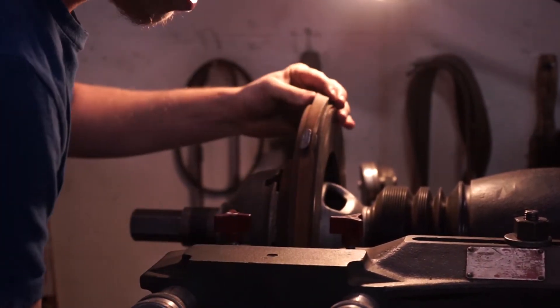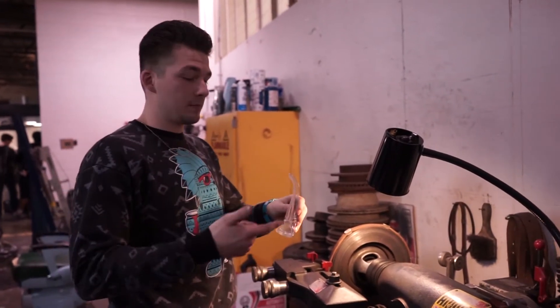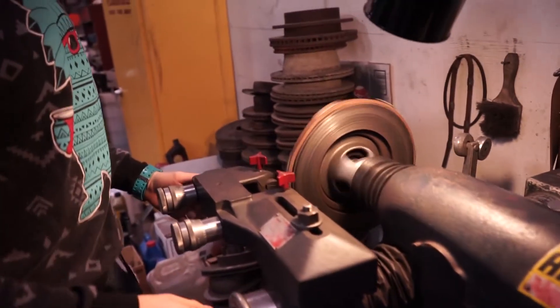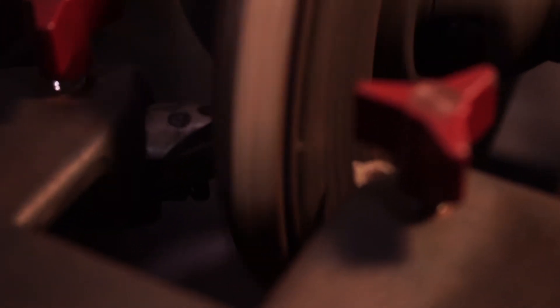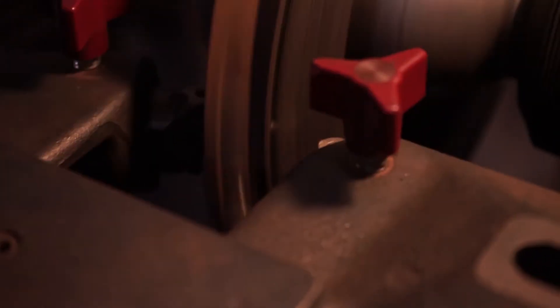Now that the silencing belt is on, you're ready to start cutting away at the rotor. Alright, approaching the brake lathe — make sure you put your safety glasses on. Making the first cut: get the rust ridge, turn the baby on, loosen her up, take it to the middle, go towards slightly touching the back. You want to hear that scraping noise.